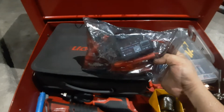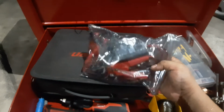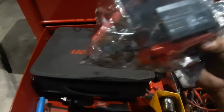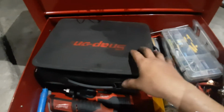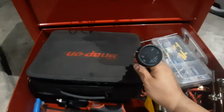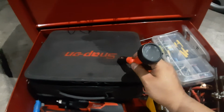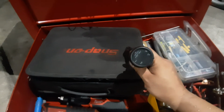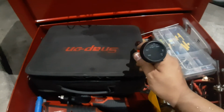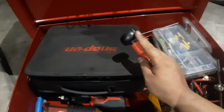I actually have in here, just to let you know, a Bluetooth battery tester. I forgot what the brand is, but it does become useful every now and then, but it's not as useful as this one. If I do a test drive, I just plug this one inside the cigarette lighter. One, to double check if there is power on the cigarette lighter, and two, to check the charging rate. And it displays the atmosphere temperature as well, or the room temperature, because of this sensor,